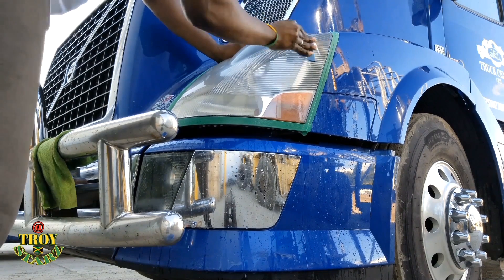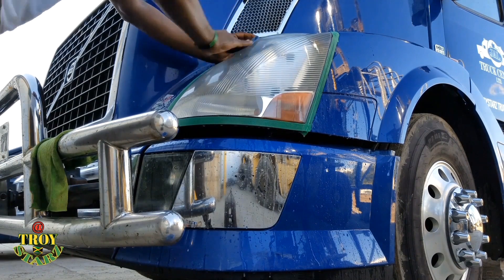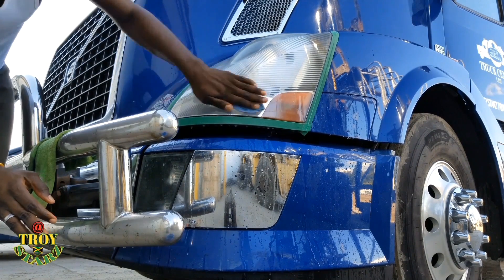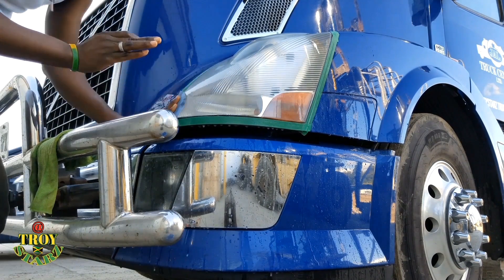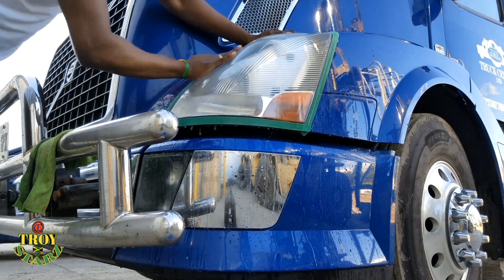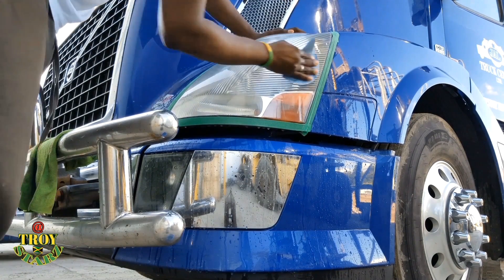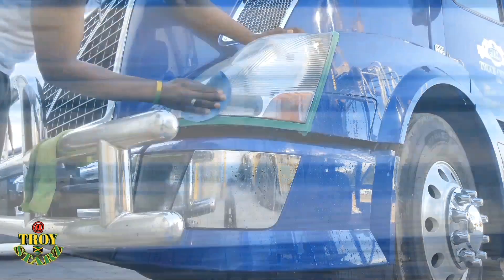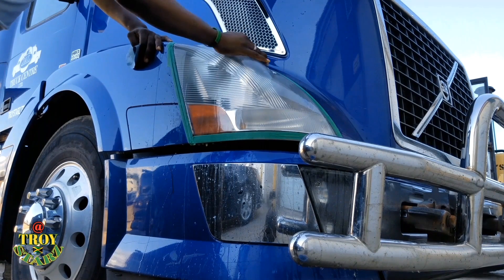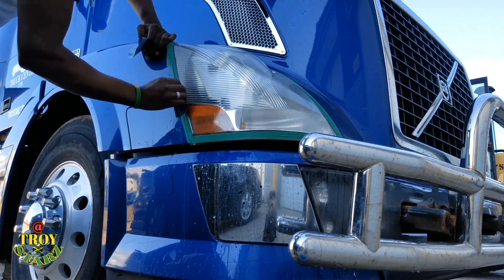If the 1,000 left any scrapes or scratches on the plastic, this 3,000 grit will get it out — put it back smooth, like before — before we start polishing. That's the purpose of using the two sandpapers. You can go three if needed, depending on how bad the light looks — you might need a rougher sandpaper. But the 1,000 and 3,000 work fine. You've also got 1,500. I just needed the 1,000 to start and get off that old polish, then the 3,000 to smooth down the light — and when I look at it, it is so smooth. All I need to do next is put on the polish.